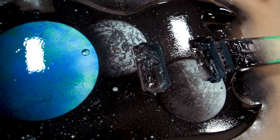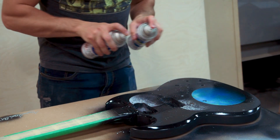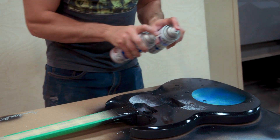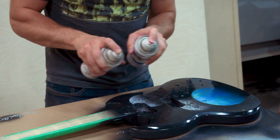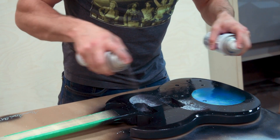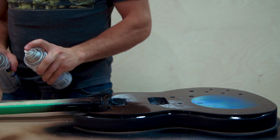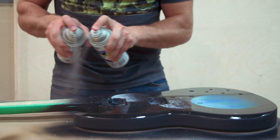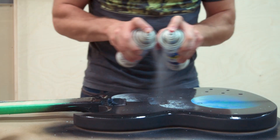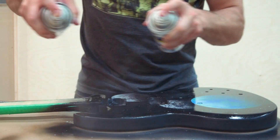You can clearly see quite a bit of texture in that first wet coat. That will level off a little as it dries — most paints self-level somewhat. We're doing more than one coat: one to help level it more, and two to make sure we've got enough paint build-up so we can sand through to flatten it back out. That's how you bury graphics — add a few coats. We'll do about three coats per session before we let this thing dry. If you do more than three or four coats you run the risk of the first layers not being able to dry properly. That's round one — three coats, about ten minutes apart.